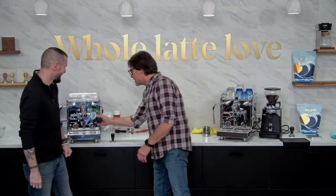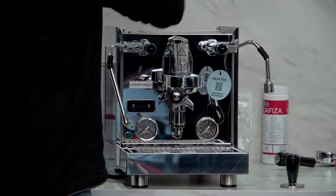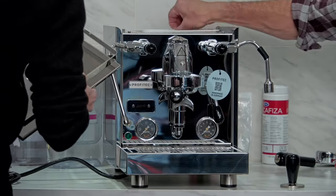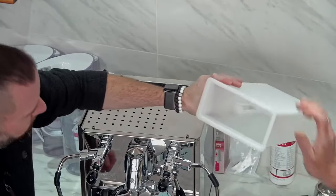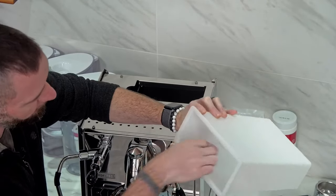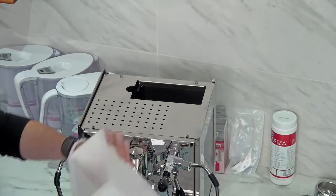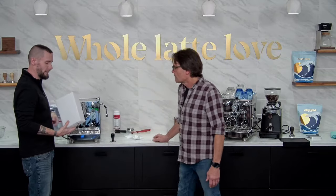Let's get this started up. First step is to take the top off and get some water in the reservoir. One thing worth checking is the float inside here — there's a little cap and a little float inside. When the water goes up, it raises the float, and that senses that there's water in there. So if you plug the machine in and it doesn't power up right away — you've got no lights on your PID but a green light on — just check to make sure that float is in there.